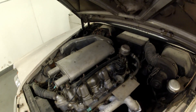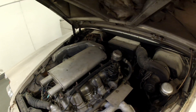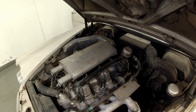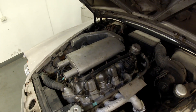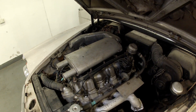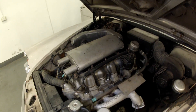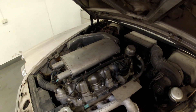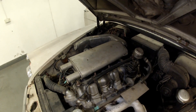What's interesting about this engine is that it's called an IOE engine, or intake over exhaust. It has an overhead intake valve and a side exhaust valve. The reason for this was that Britain at the time had protectionist-style tax law for cars — you paid road tax based on the fiscal horsepower of the engine, which was related to the bore size. So a lot of British engines of the time had a long stroke and a small bore, and companies had to come up with innovative ways of getting valves big enough to allow the engines to breathe. Rover came up with this arrangement allowing quite a large intake valve, and with the side exhaust valve it gave them almost an upside-down hemispherical combustion chamber with these very tall skinny valves.